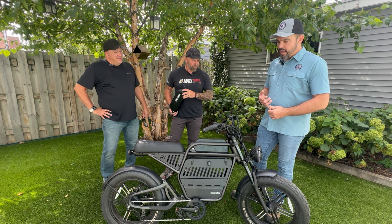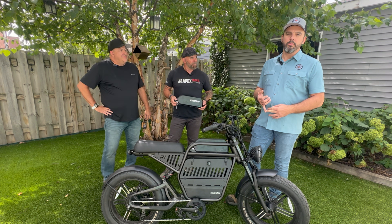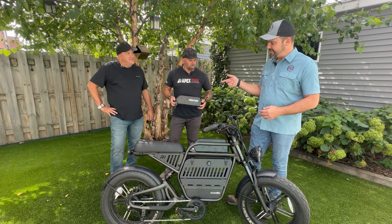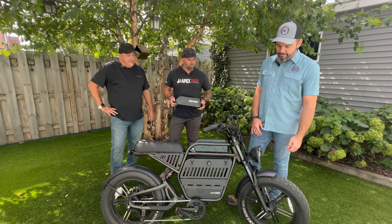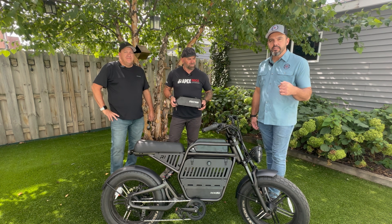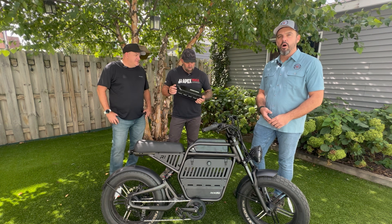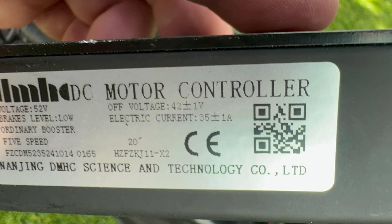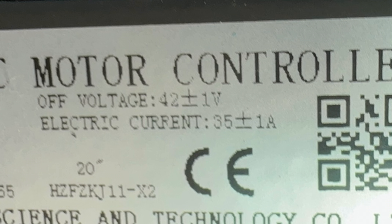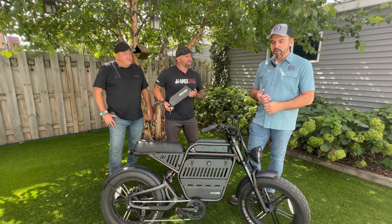We're going to use a 40-amp dual battery discharge balancer kit — the universal kit from Electric All-Wheel. If you're feeling like you might ride the higher-end spectrum of current output, you might look at the 60-amp. Please know that it's XT90s, not the XT60s that this battery has and what's on the controller for the Rev1. We'll leave links for all the products in the description. You are not isolated to this battery — you can get any 52-volt battery. Make sure the BMS can handle the max current limit of the bike, which I believe is plus 30 on the Rev1. You need high amperage to get that high-end speed.